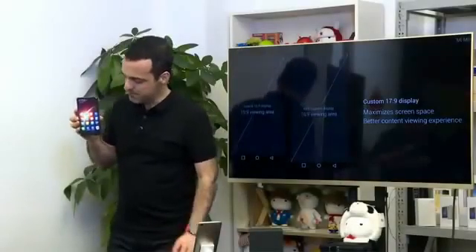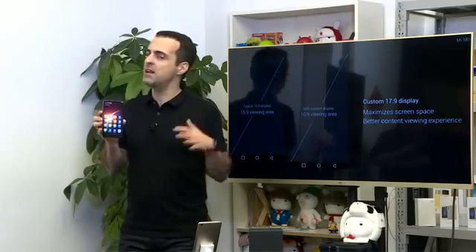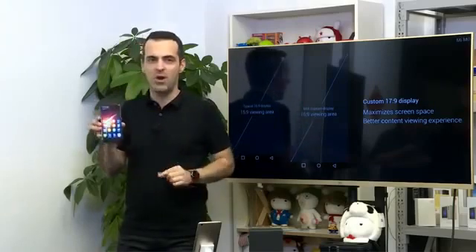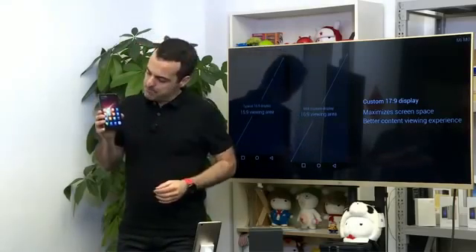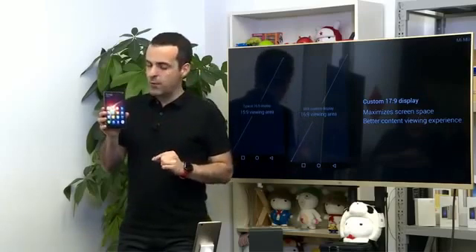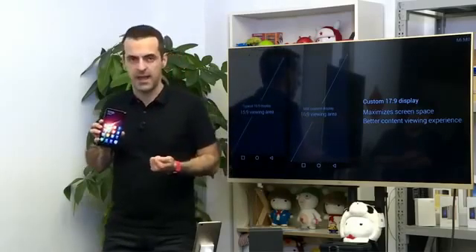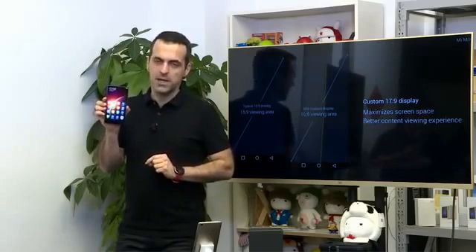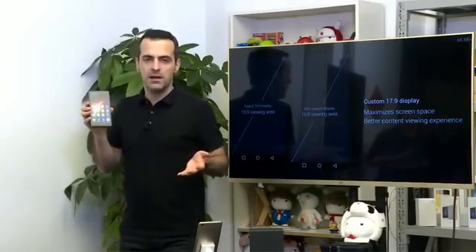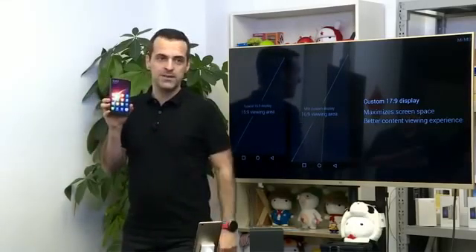We also made a decision about aspect ratio, which has to do with basic ergonomics. Most mobile phone displays are 16 by 9, and that works well because you have that enormous forehead and a chin, so the phone feels nice. But when we cut away the forehead and made the chin much shorter, keeping 16 by 9 would actually look a bit square-like. So we made the screen even longer to give you a 17 by 9 aspect ratio. It's still perfectly Android-compatible — the usable area is 16 by 9 — but it's a beautiful 17 by 9 display.